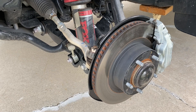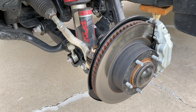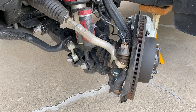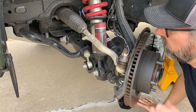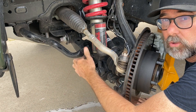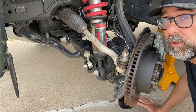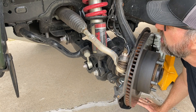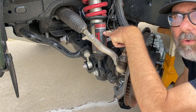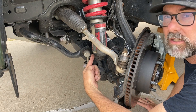I need to turn the wheel so we can see some of this better because the brakes are kind of hiding it. Now we can see quite a bit more. Here's the stabilizer bar and you can see that it connects directly to the lower control arm with this little link. The steering operates on the front, ahead of the axle, which is common when you have a longitudinally mounted engine. Big ventilated rotors, but we still can't see all of the shock, so I'm going to have to do a pan. What's important to notice is this is the remote reservoir right here, and it connects through a hidden passage that's in this bottom piece into the bottom of the shock body itself.